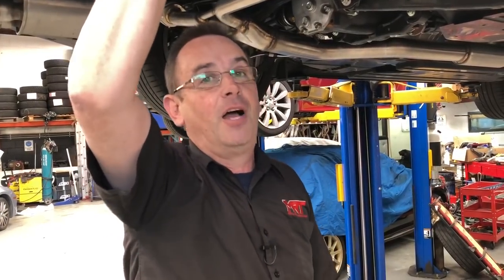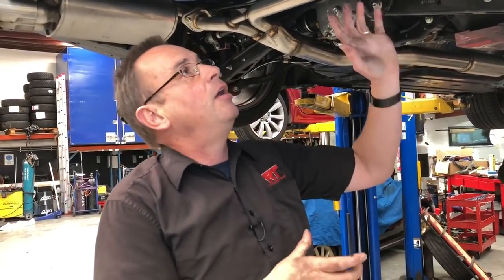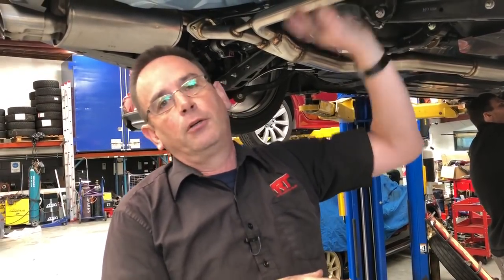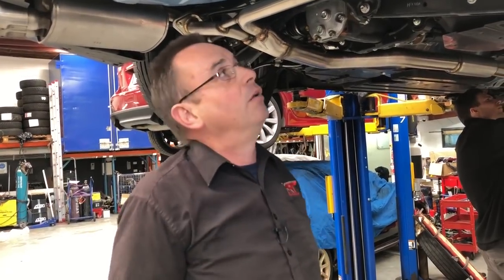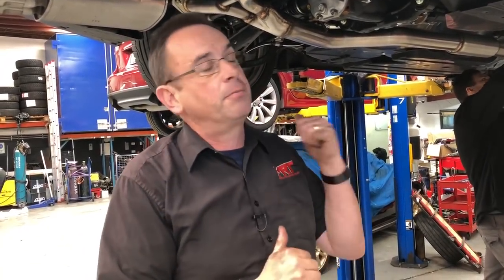We've tested this exhaust system straight through and also with the factory muffler, and the difference in performance is about one or two kilowatts — because these mufflers are actually quite good. If you want something stealthy or not ridiculously loud, the factory standard rear mufflers are a great choice. If another supplier is trying to sell you a rear muffler without telling you this, chances are they haven't done the testing. That's fine if you want an aftermarket option — but from our point of view we're trying to keep the XB kit to minimum cost for maximum value. So there you have it — the XB Power Kit from MRT Performance, made and designed in Australia. Go to mrttuned.com.au, download the power kit document, see all the dyno graphs, and follow us on Facebook, YouTube, Twitter, and Instagram. My name is Brent Middleton, thanks for watching.